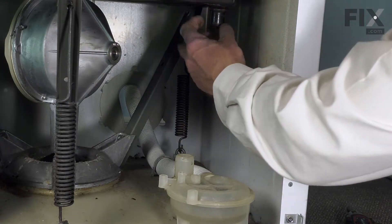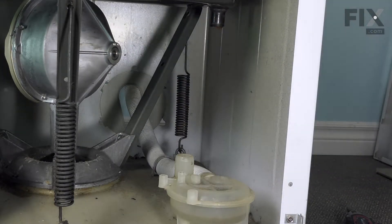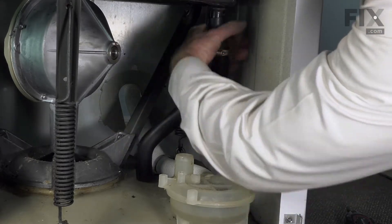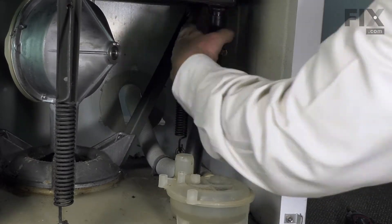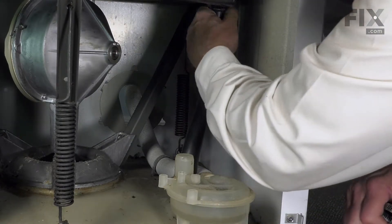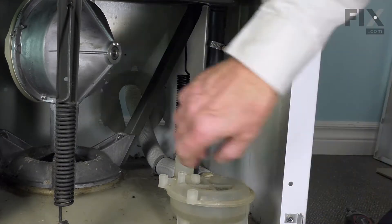Make sure that the outlet nipple from the tub is clean. Then fit it firmly onto the tub, make sure it's pushed right up to the bottom of the tub.